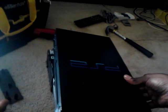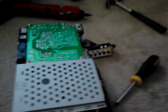Now whenever you have all those screws in, do not put this top part back on like this. That's upside down. Put this one in, make sure that this part with the fan and the power button fits with the part that does not have this large opening. So like this. Now if you have trouble putting the ribbon in, it was probably because the top of the console was upside down. There's no screws you need to put in on this side. So yeah, now you just whip it over. Fit anything back into place that came out from you turning it upside down.